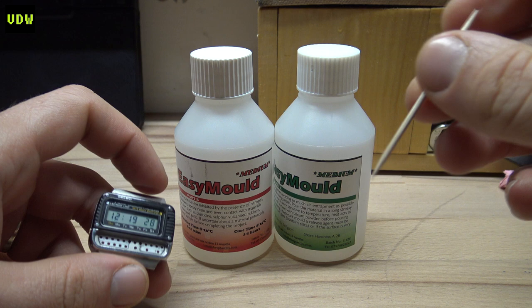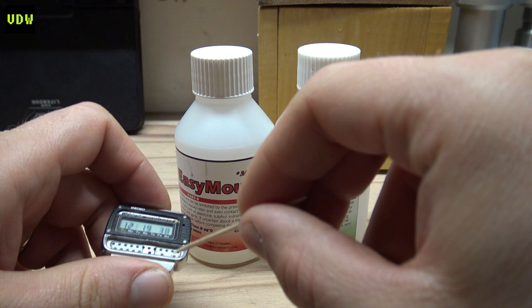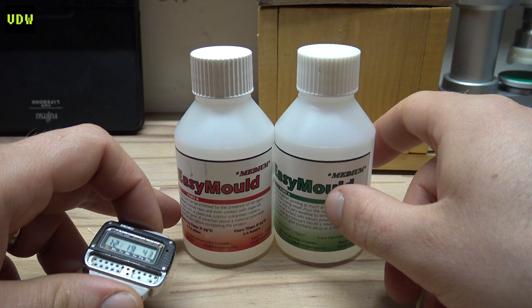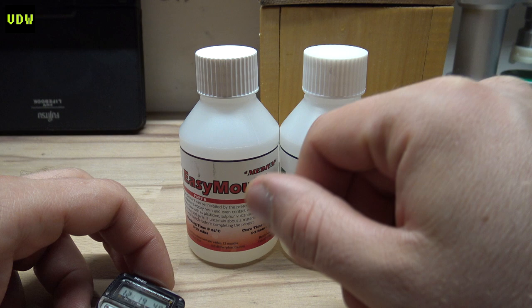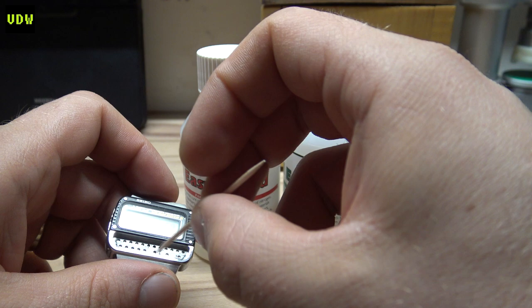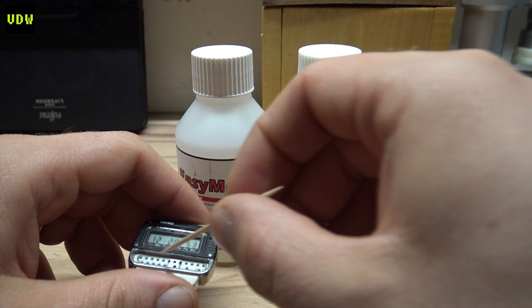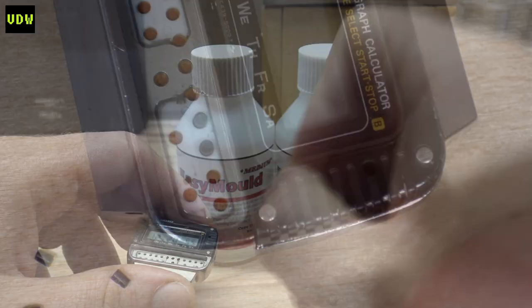Now we're at the crucial step of this fix. We're going to place those studs in the little holes and then cover them with a layer of silicone. I'm using two-part silicone because that's what I have on hand. It's important to use transparent silicone because once you pour it those little studs may move — you need to see through it and use a needle to straighten them right after the pour. Now we place the studs, mix the gel, and apply a thin layer with a syringe.